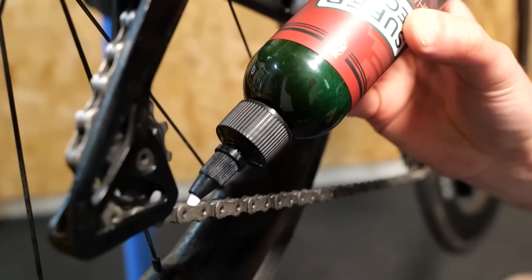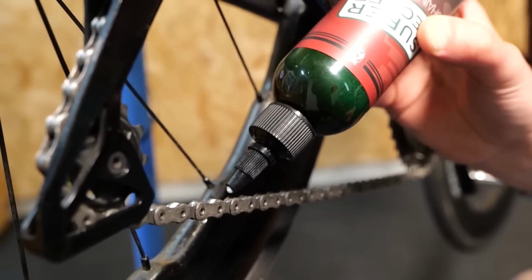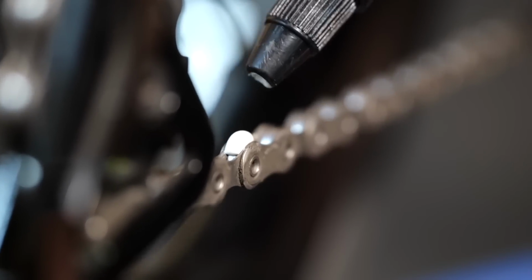I think it pushes us to think really differently than we would for, say, a bearing or something in a much more controlled environment. And the state of modern chain lubes has kind of settled on wax, which, interestingly, we can trace the roots of wax-based chain lubricants all the way back to World War II. You think of the B-17 bombers with these chain-articulated bomb bay doors.